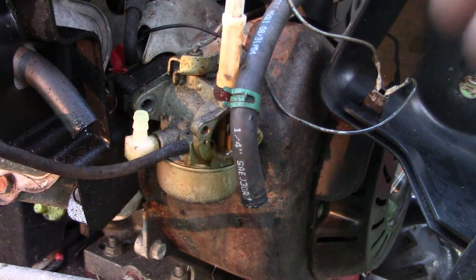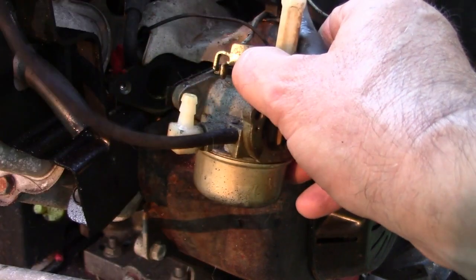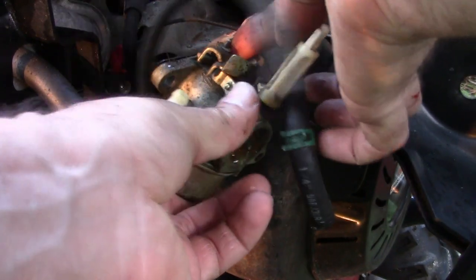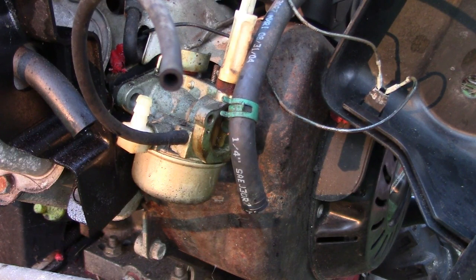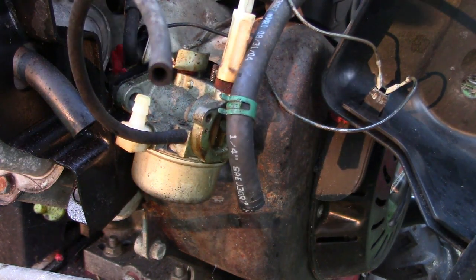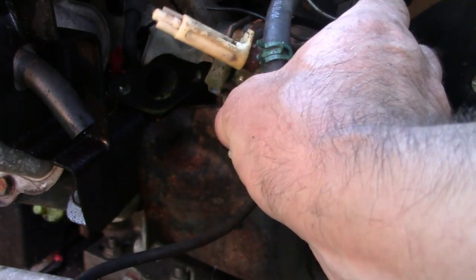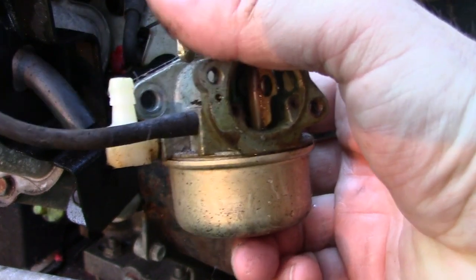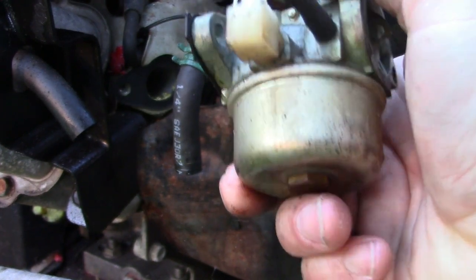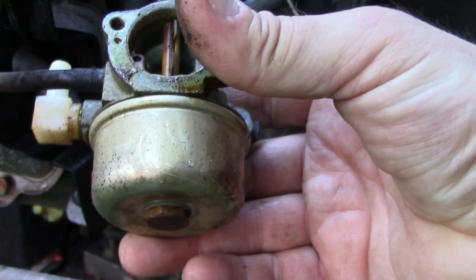Sure a lot more enjoyable doing this in August where it's nice and pleasant and warm. I just don't like to be cold. Here's a spacer, so that's coming out too. The carburetor is now free. I'm going to take this bar off — there's a thin wire as well as that hook. First take off the thin wire, pull that off, and now this should come out just by twisting the carburetor. There it is — completely comes off. The primer hose is still connected, and if it's old and cracked, that'd be a good thing to replace.